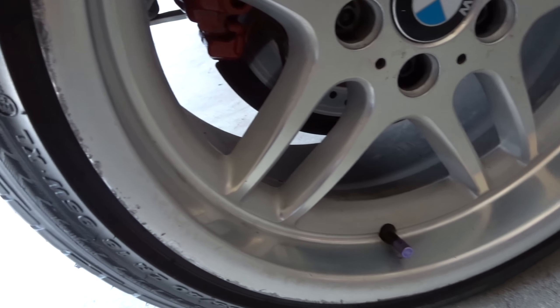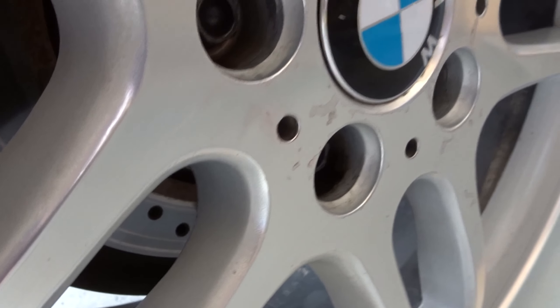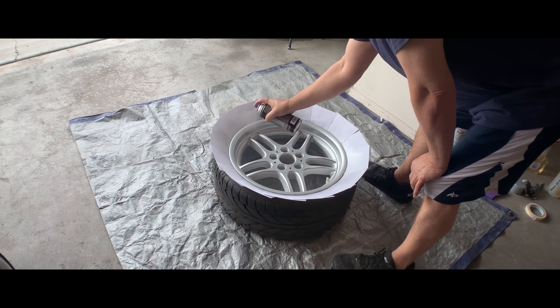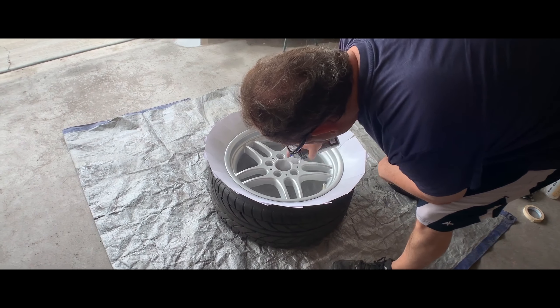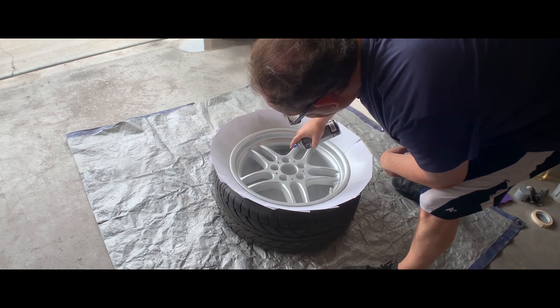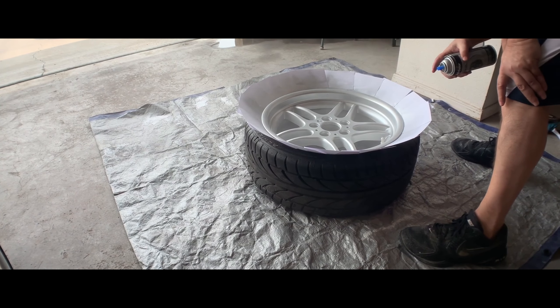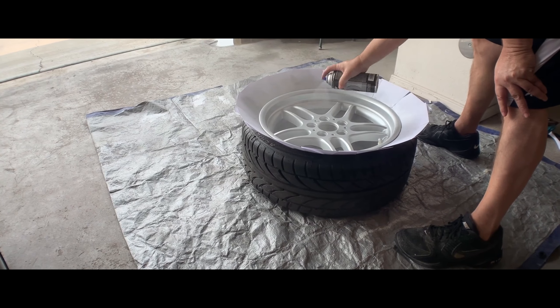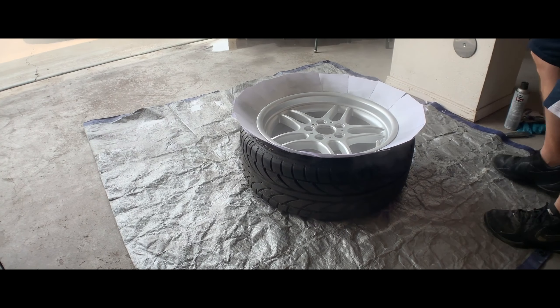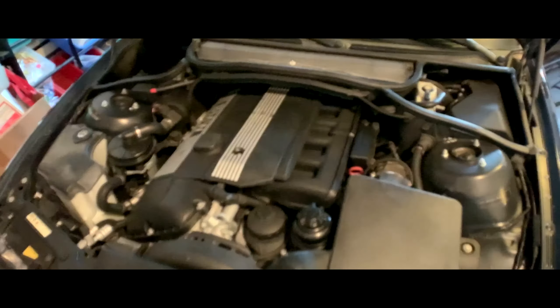Let me know what you guys think about these DIY wheels. If you're going to want to paint them a different color, like maybe black, you're probably going to want to get some primer first. Especially if you're going to sand down the base coat from your existing wheels, go ahead and get some primer so things will stick on easier and last longer. For these wheels, it was just curb rash and light chemical stains, so not using primer really doesn't matter. But if you're painting a whole other color, just use primer.